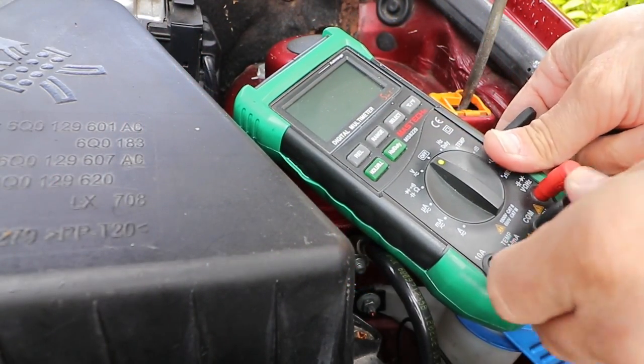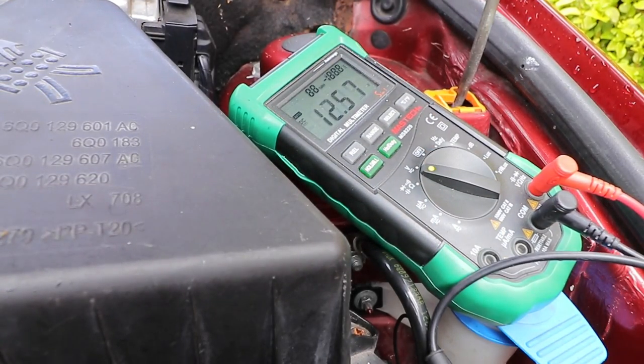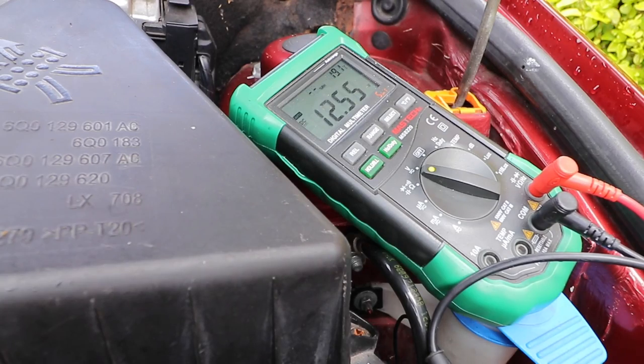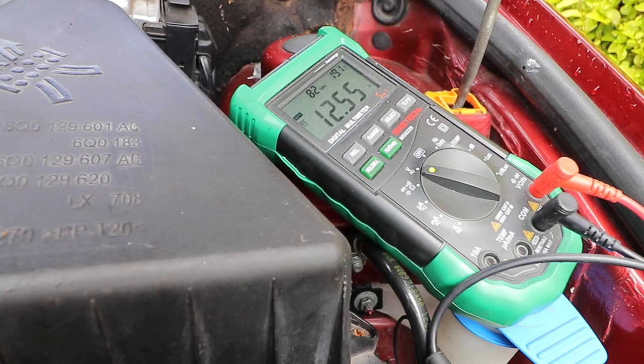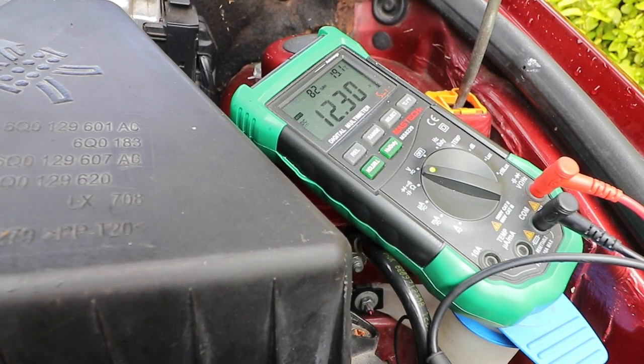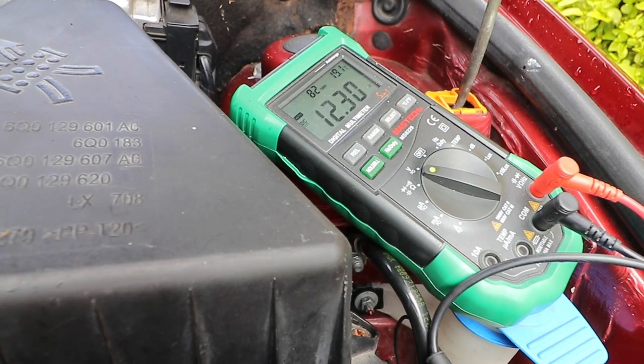Back again in the morning. Just connect my leads and we've got 12.55, just under 12.6 volts, which should be okay. I'll start the car now and leave the voltmeter attached just to see the voltage drop. When I open the door and put the safety lights on, the voltage drops — down to 12.3 volts. You wouldn't expect that to happen; they're only small lamps. So this doesn't look very good.